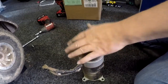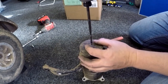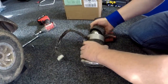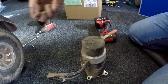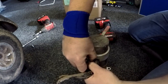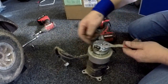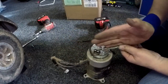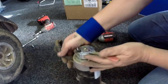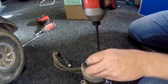These connections all have retaining clips on the controller, so be delicate — you don't want to damage the retaining clip. That's the motor off. Now I've got the motor off, I need to take the electric brake off to put onto the new motor. I need to remember that the main loom is at 12 o'clock and the brake lever sits at 7 o'clock, so when I put it on the new motor I know exactly where it goes. This one has three screws holding the electric brake on.